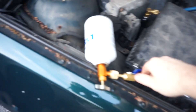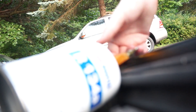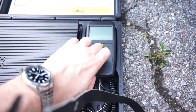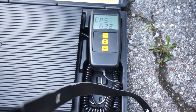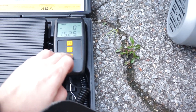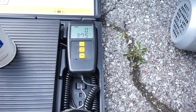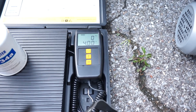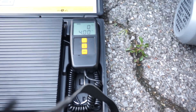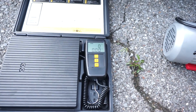I'm going to close the ball valve and remove this can of refrigerant to switch it out for another one. We'll go to the scale. The empty can weighs four ounces — bang on — so we know we just added 12 ounces of refrigerant. The manufacturer's not lying. I'm going to add all three cans so we'll have about 36 ounces in there.